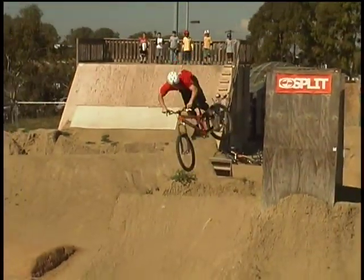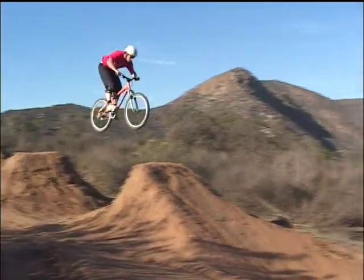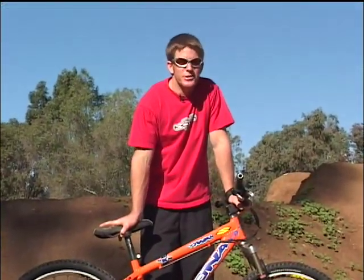As far as everything else goes, it's really not that important, as long as you're riding stuff which is designed to do what you want it to do. You come out here on a cross-country crank and cross-country bottom bracket, you're just going to end up breaking them. But everything else, hardtail, full suspension, single speed or 21 speed, V-brakes or discs, that's just all hype and whatever you feel good about. So just don't buy into it and just do what you want to do.